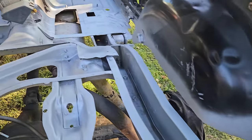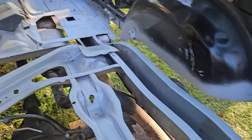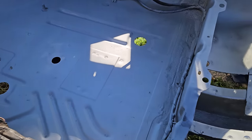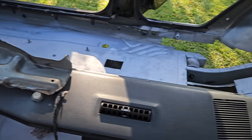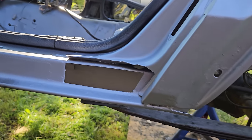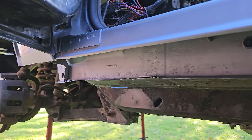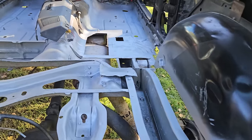So there we are, everything has been sprayed - everything that's going to be welded and that's exposed metal that the grinder's touched, because obviously when the grinder touches something it's going to rust a lot faster. I'll just use the standard primer in here because I'm not going to be doing any welding in there - it's really just to offer some protection for the bare metal in the week to come before it goes in the garage. I really don't care about all this because I've got new weatherstrip, so that's all going to be put on. I'd rather the weatherstrip stay on while it's out here because it's going to stop water getting in. But yeah, it looks cool - at least everything's covered now, everything's protected and it's now ready to put in the garage and do some welding.